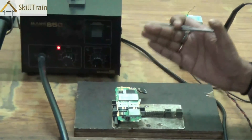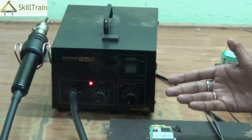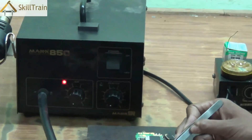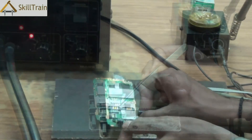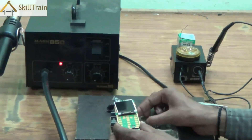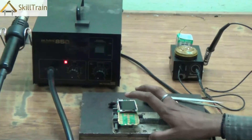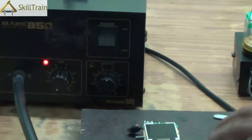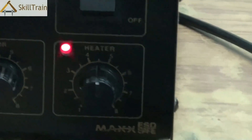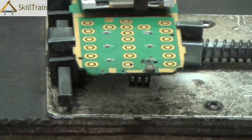Let's understand how we can remove this battery connector and replace it with a new one. To remove the battery connector component, we will need to use the SMD, also called the hot air gun. Before we remove the battery connector, you need to turn the board around and place it with the front side facing up — so the display side is on top — and then use the SMD to remove the battery connector. We have set the SMD at the right temperature and there is a steady flow of hot air coming out through the nozzle. Now focus the nozzle at the battery connector point exactly where the connector is placed.